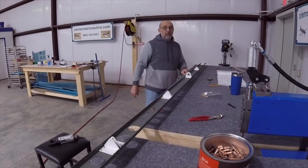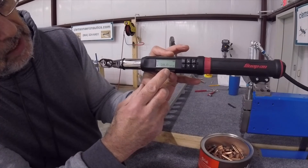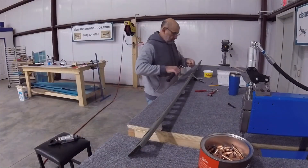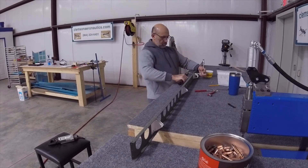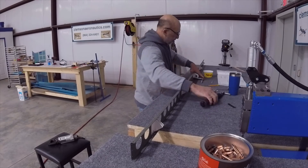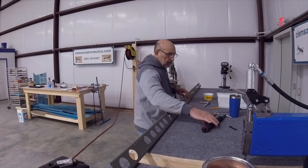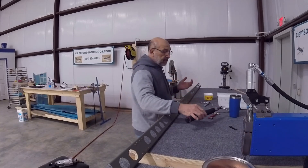I'm going to see if my torque range will go down that low. Now I set up my torque wrench to 28 inch-pounds. You have to be careful not to do it in foot-pounds because some people make that mistake — so make sure it's 28 inch-pounds. The torque on these nuts doesn't take very much to exceed, so like one of those nuts I think went up to about 30 just by doing it normally. It's very easy to exceed, so be careful with that.